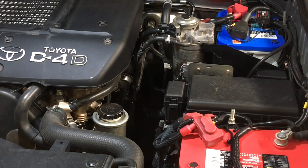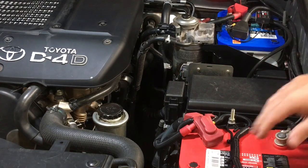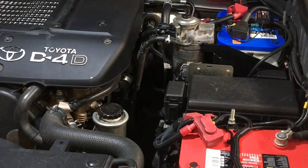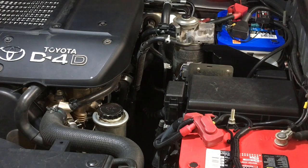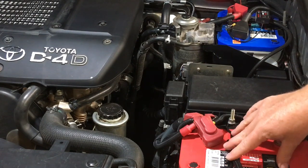Other batteries can fall to pieces literally inside and leak fluid. These are AGM — Absorbed Glass Mat — a dry battery, no acid to leak. You can mount them sideways, probably the safest battery to put inside the vehicle. Some people don't want the battery under the bonnet due to guard cracking. For us, when going to remote places and travelling as a family, we need every cubic inch of space in the back, so everything stays under the bonnet.